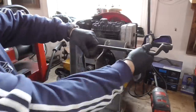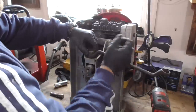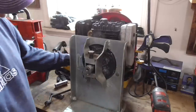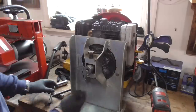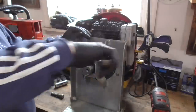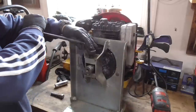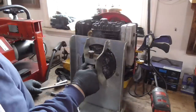I'm not really using this crankshaft bender the way you're supposed to yet, because I can't even get the sleeve on here. I'm going to bring up this bottom bolt a little bit just so it meets, then bring this down. It's possible you can break the whole block, and usually the crankshaft kind of flexes back when you use this thing. They do take some getting used to.